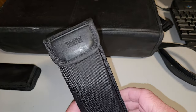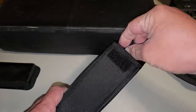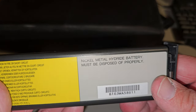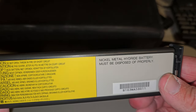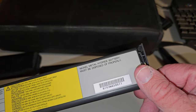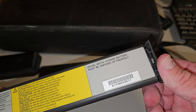These are actually spare batteries, labeled ThinkPad. Now these batteries no longer work, but I've heard you can rebuild them. This is the official IBM laptop battery — nickel metal hydride, whereas now we use lithium ion. IBM decided to go with nickel metal hydride, and these have a tendency to leak, just like it did on this machine quite severely, which actually damaged a little bit of the inside. So the speaker's not working great and the headphone jack is a little bit messed up.